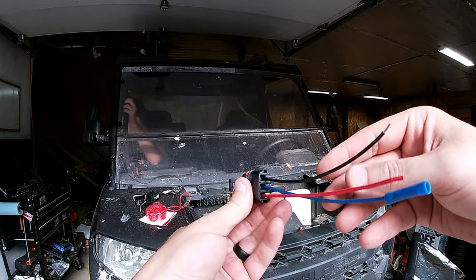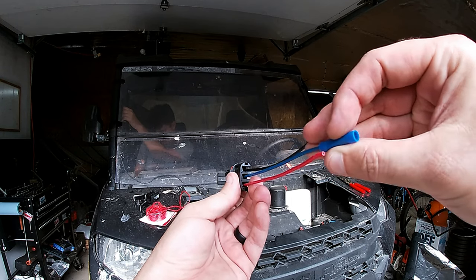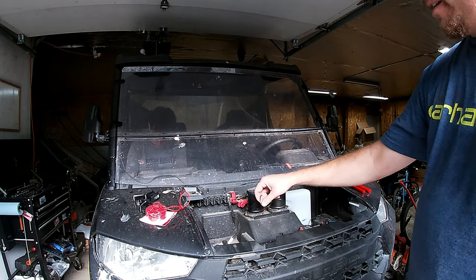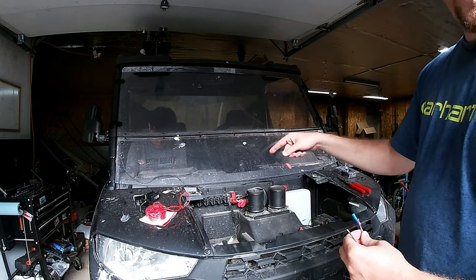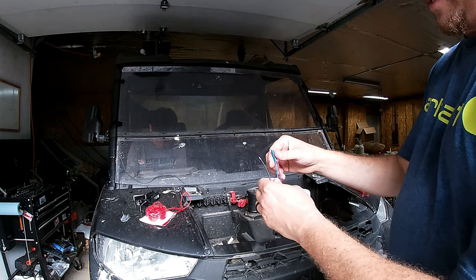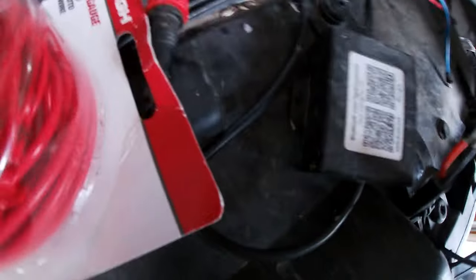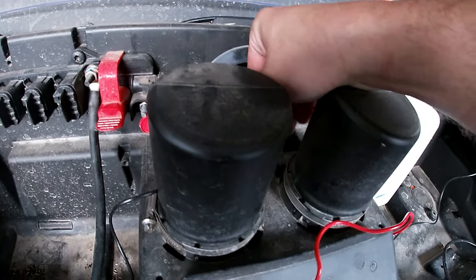To the passenger side: the black top wire is your ground, the middle blue is accessory power with the key on, and the red bottom is hot all the time. I ran this black wire through the firewall — that's to the negative on the USB switch — and we're going to put that to the negative on here. Then we'll run another red one to the power, same thing. It splices in here and then that's done — takes like five minutes. Now I've got the red wire with the spade connector going through the firewall.